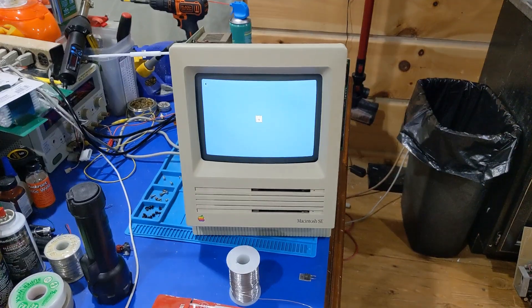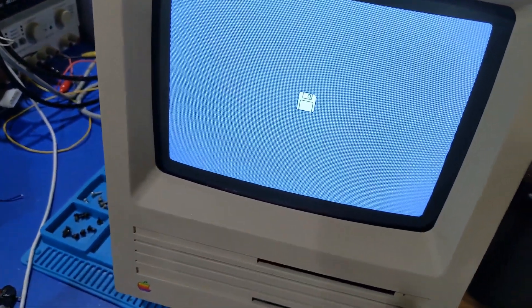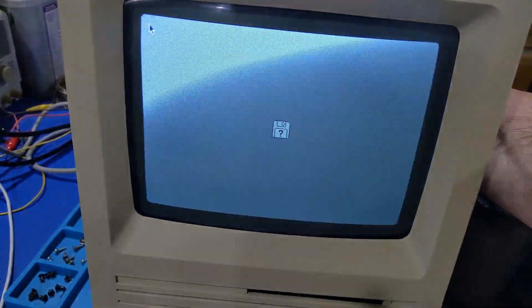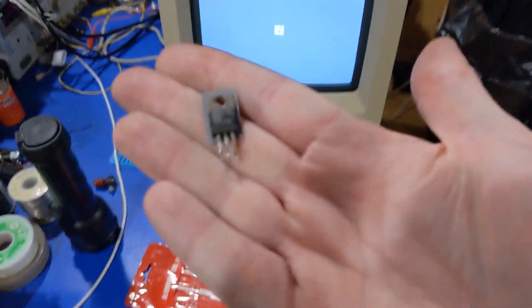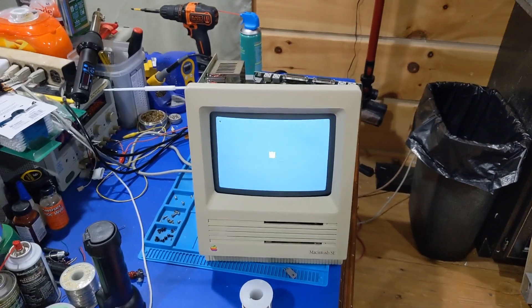So it's like that transistor is noisy. Problem solved. Now I gotta get the centering rings adjusted right. Trying to get this adjusted right is no fun because I get OCD like that. Anyways, horizontal output transistor was bad. That's why.